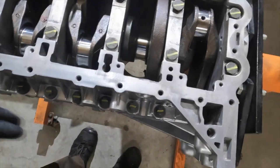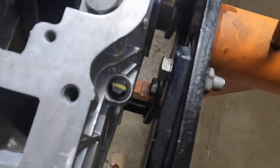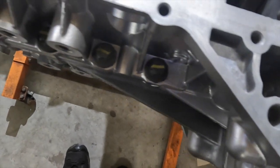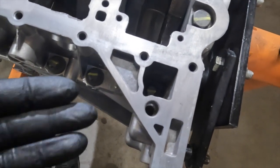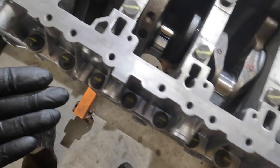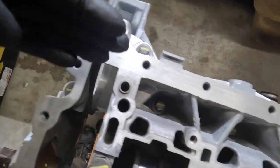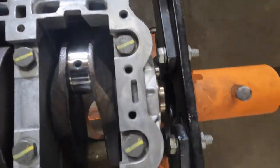Okay, so all the aluminum bolts have been torqued. You can see they've all been turned 90 degrees, so we've got the markings aligned. This is a great visual indication to make sure all your bolts have been angle torqued. Now you can just go along the line and see everything is along the same line, so you didn't miss any bolts.